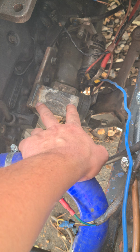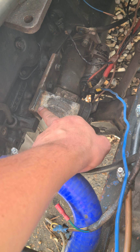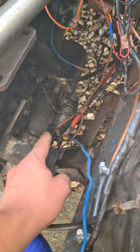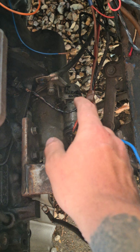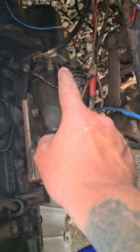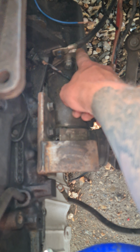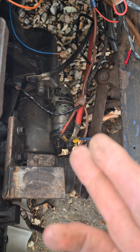So yeah, basically your engine mounts are homemade, so 3 bolts in there and 1 here. This is basically homemade, just so it has the original Zetec, the original Pinto starter motor with 12mm spacers. So this is when the starter motor engages, it then gets onto the flywheel, because if you don't have the spacers, it will be on the flywheel teeth altogether.